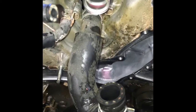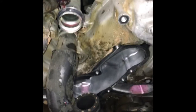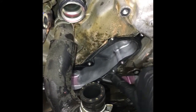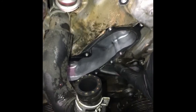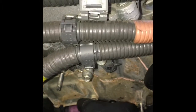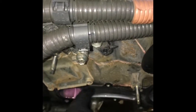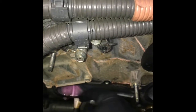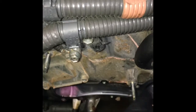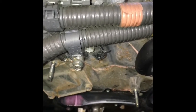After removing all the bolts that hold the water pump on, we're going to clean our mating surface. Use rags and maybe a little razor blade and scrape it a bit to get off any debris stuck on there. Don't use a die grinder or abrasive wheels, because this is made out of aluminum and it's really easy to create dips and valleys in the soft aluminum — then your new pump won't seal. Just scrape it off with a razor blade.